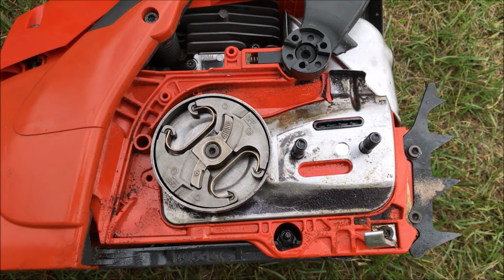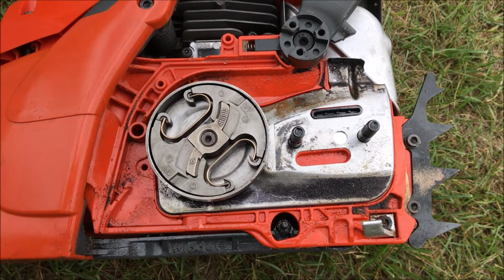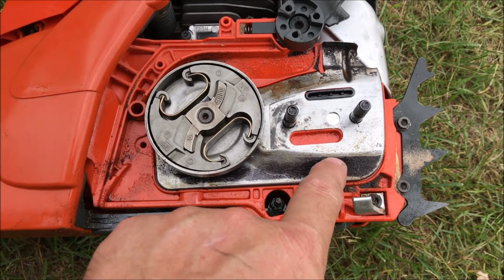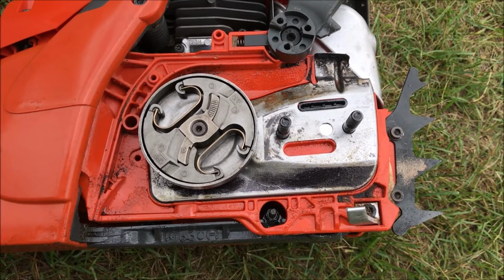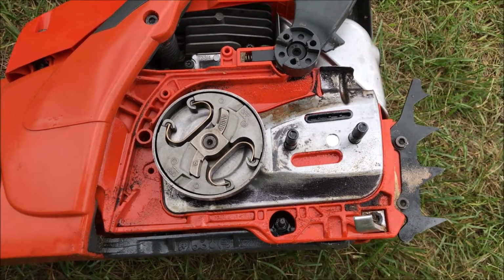But as received from Husqvarna, this one had a defect. There was no oil making it from the oil reservoir to the bar. So I ended up burning the chain into the bar effectively. You can see everything is black here from all the burning that went on. And I destroyed that little pinion gear on the oil pump. Gladly, it only cost 11 bucks for the part. I've been screwing around for a day and a half trying to troubleshoot this thing, but I'm ready to go start cutting wood again now.